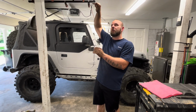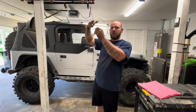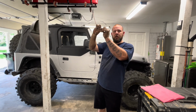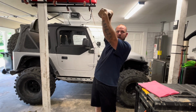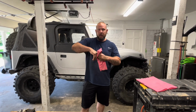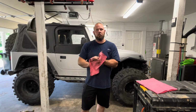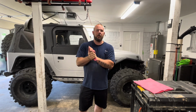The most difficult part is on the transmission, well, on the pull lever, that piece, you put your pin in, and then you have to put a nut, and then there's a little bitty like 10 mil nut on one side, and then it's a nylock on the other, and there's no room to get in there with both your hands comfortably on both sides of that drive shaft. It is a fight, because the drive shaft does make that very difficult to do that part, but it is doable. Just take a deep breath, gain your bearings, and just one ratchet at a time, and you'll get it in there. And this job, I did mostly all of it with a 1/4 inch ratchet and wrenches.